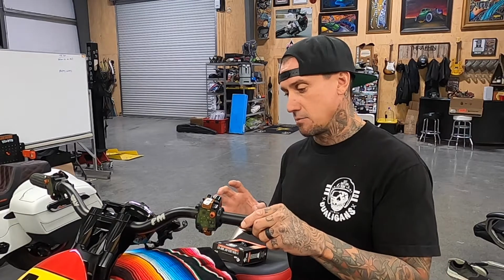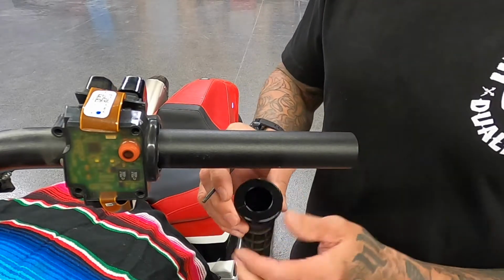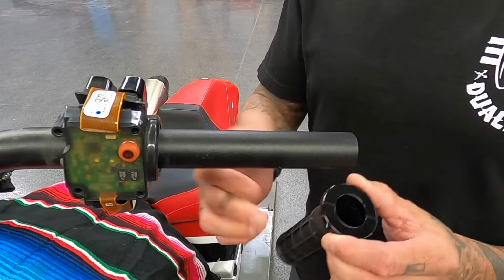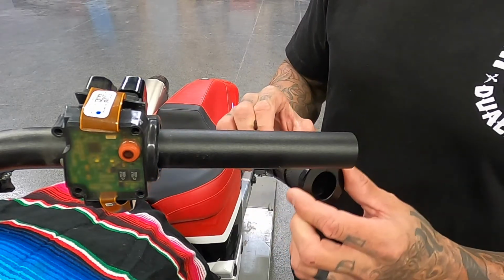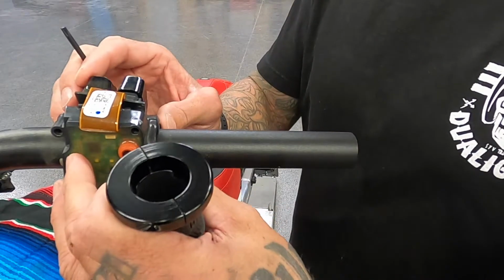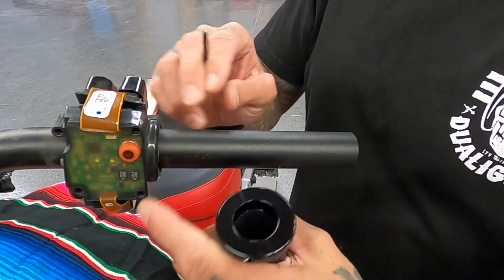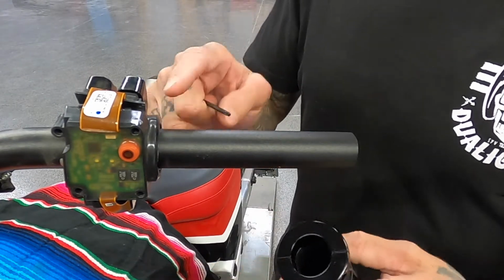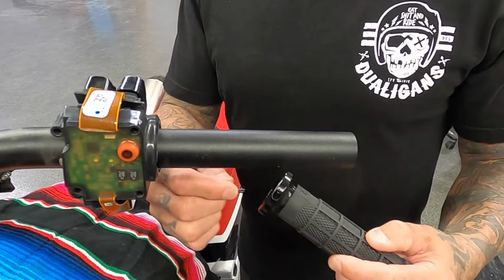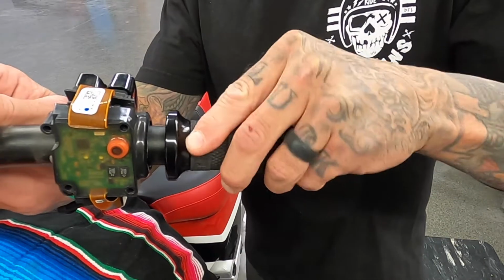So a couple key things that will just kind of save you a little bit of time. All right, so first step, very simply, the great thing about this locking system is there's no having to drill that cheesy little pilot hole into your handlebars. All your locking power is right here in the front. Now, once you remove the stock grip, traditionally on the Indian baggers, you have to open up this housing, and the little flange has to slide underneath here. The great part about these new grips is that goes away. So what I do is you don't even have to take this all the way off, just loosen them to where this kind of opens up a hair, and they just slide right on nice and sweet.